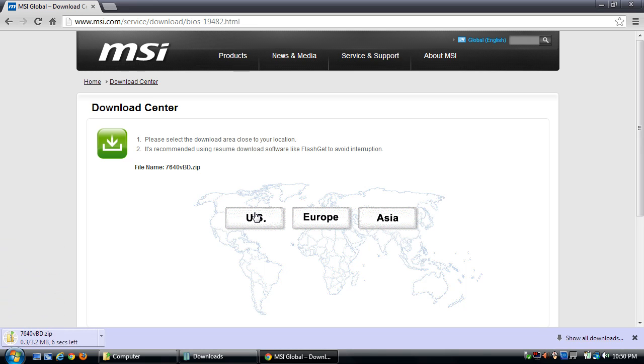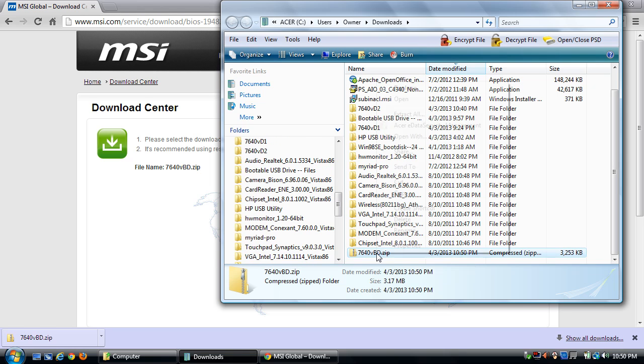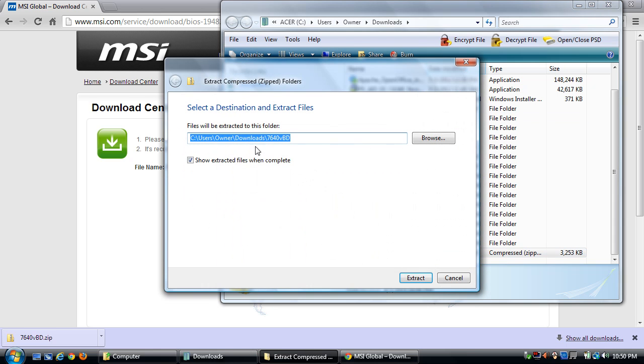In this case, I'm going to MSI and downloading the file I need for my computer's motherboard. Now on this particular board, since Windows 8, MSI has moved to presenting the BIOS as a single downloadable exe. I'm going to download the BIOS that is still presented as two individual files, the utility and the BIOS. For illustration here, it's version 11.13.